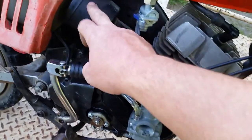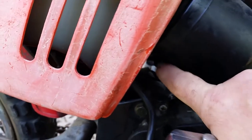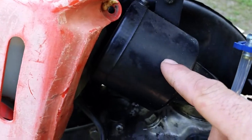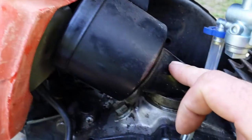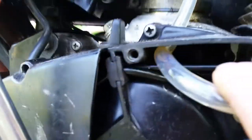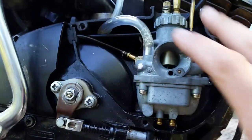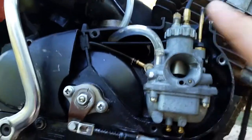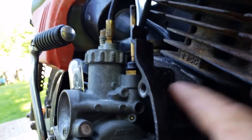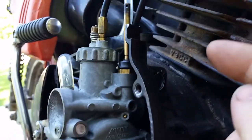Now, what happens is your air filter is in this box right here. The fresh air comes through a little inlet down bottom, flows through your filter, and gets cleaned. So only clean air goes through the center of it, travels down this intake boot into your engine, and comes over this way through this whole opening area right there. Then it comes around and fills up this whole side cover, this whole air box, with air. Now, if you have this plug off right here in the back, you're bypassing the air filter. So dirt, water and debris will get in there and fill up down bottom.